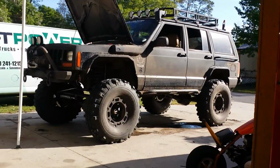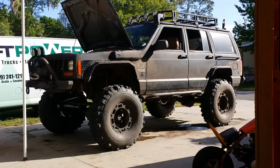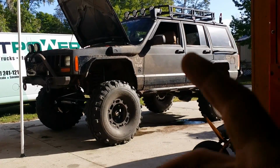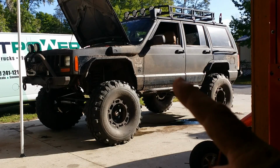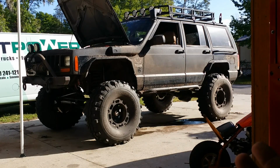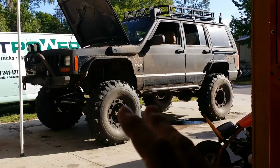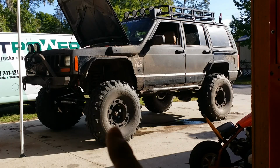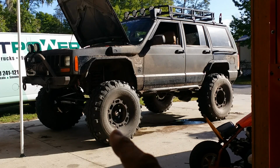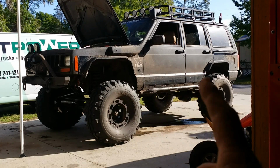when I mud raced for many years, you have to consider the Jeep like a toy. It's a toy. You go out there and beat on it. You bring it home and you work on it for a week. And there ain't nothing broke on it or anything like that, but you still got to clean all the crud out of it and make sure your wheel bearings haven't got any water protruding into them. Your diffs, definitely, you got to check your diffs.